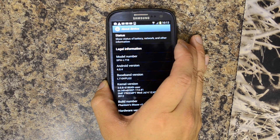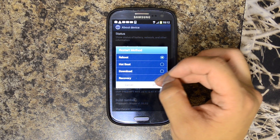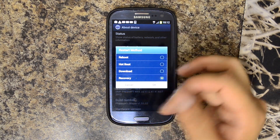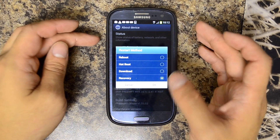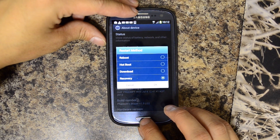I've downloaded it and placed it on this device. I'm going to go ahead and restart into recovery. A couple of ways you could do this: if you didn't have this little 4-in-1 restart, you could restart it and as it restarted, hold volume up and home.